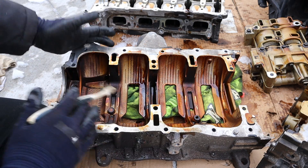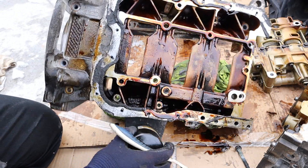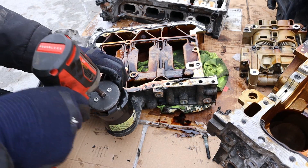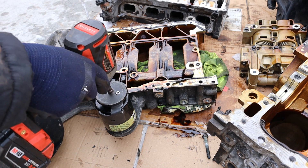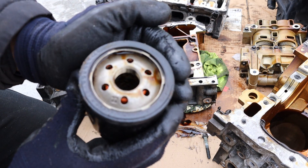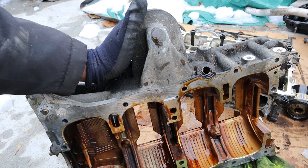Starting here at the upper oil pan — there's not too much to see other than its shape. This kind of acts like a baffle because there isn't really an oil baffle at the bottom of the engine. The oil pump is going to plug into here and send oil straight up to the oil filter to get filtered out — they've got a good Mobil 1 oil filter on here. The oil is then going to be sent out to a hole which goes into the block — there is no oil cooler on this engine.